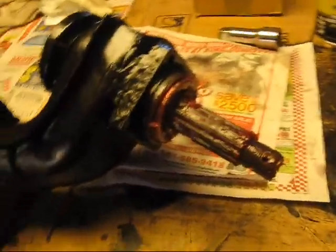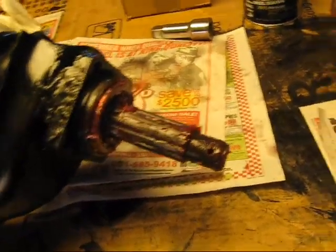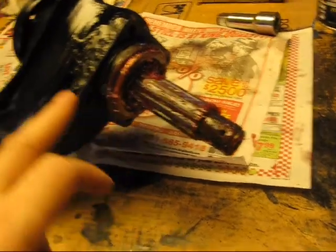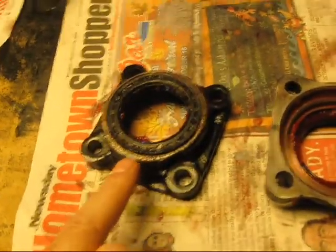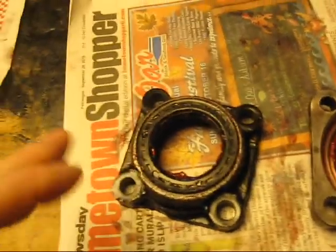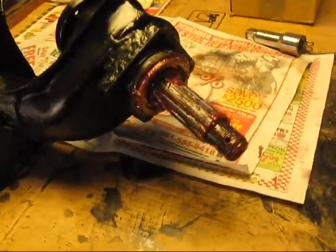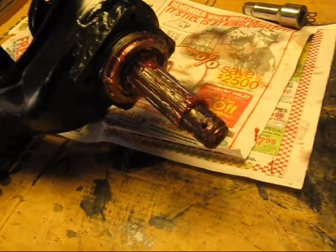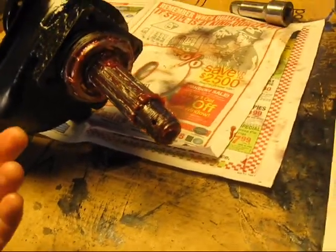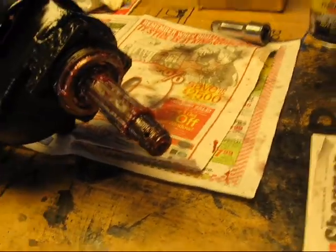Of course, cleaning up an old arm like this is absolutely filthy, and there's the possibility of dirt getting into a very closed system like this. As you can see, I've got the front bearing seal and cap. Once this cap goes on, this is a closed environment, so there's certainly nothing like being able to take this all apart, clean it up really good, make sure it's well inspected, and make sure you've removed all the burrs. I've shown you some of that earlier. Make sure all the bearings are seated, they go in straight, and that everything goes together completely lubed with all fresh lube, everything is cleaned out, you don't have dirt falling in, and you're on a clean work surface that you can control.